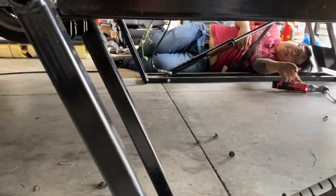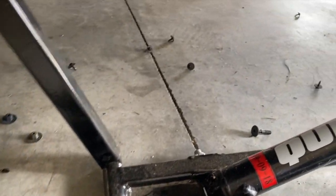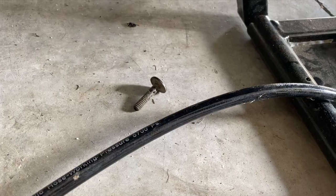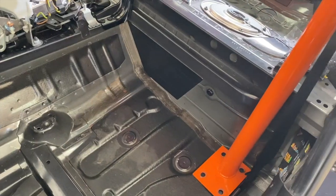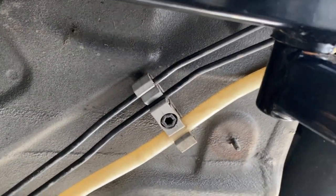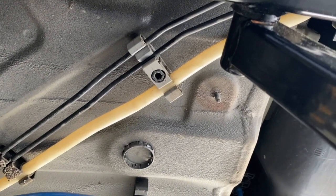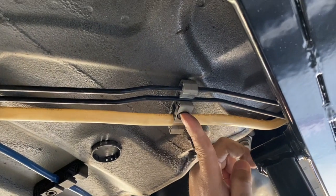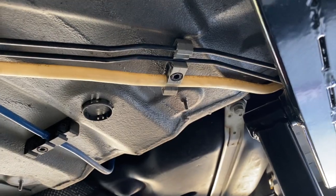Our next step was to raise the car - if you have a QuickJack, highly recommended. We have to take this bottom panel off, one on each side. It has a ton of 8mm screws, some 10mm nuts, and some T27 Torx. All of the little Torx guys along the edges are T30. What we're discovering is that some lines are right under where the cage is supposed to bolt in, so we need to figure out what to do with those. We're just going to undo this bracket with a 6mm hex and drop these lines so they'll be a little out of the way, then drill and see what happens.